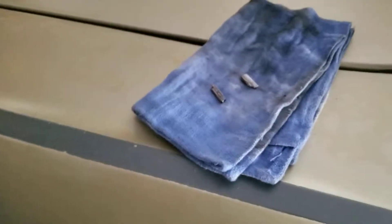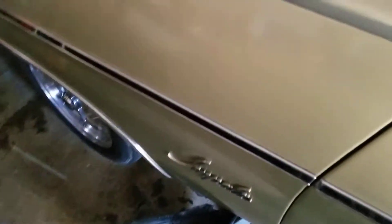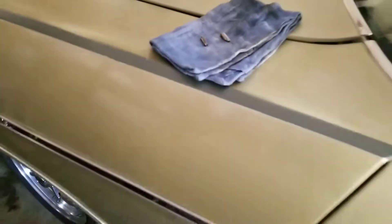I never turned the car off because I wanted to see if that was my last drive. So this is what we're working with this week. Hopefully it's just the starter — I did see the teeth were kind of messed up on the flex plate.